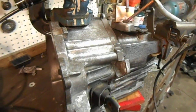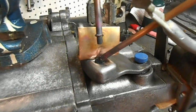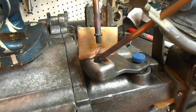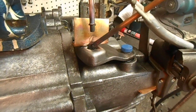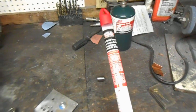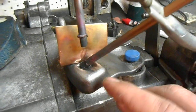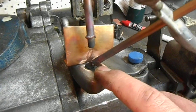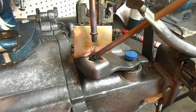So that's what I'm going to start doing right now so that I can put this transmission back in tomorrow. I could have filled that hole up with MIG wire and just used the MIG welder to fill it in, but trying to drill into weld is really difficult because the tensile strength of the weld is so dense and hard that it's hard to drill into. By comparison, these brazing rods are machinable. I don't know where I'm going to end up having to put another hole in this shifter to make my short shifter, but either way, having brazing rod in there instead of MIG wire will make it easier to machine later on when I install a short shifter.